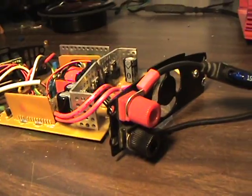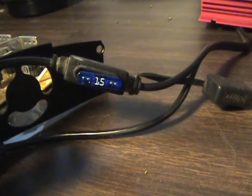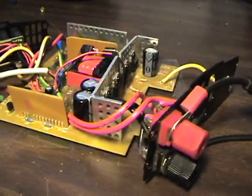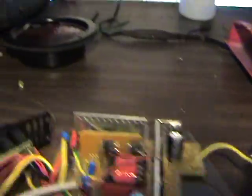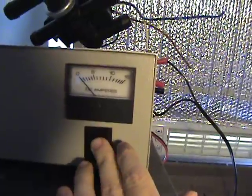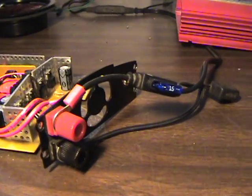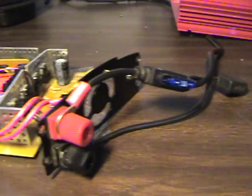I've got this wired up to my power supply, and just another word of caution — I've got a 15 amp fuse in there, but a 7.5 amp fuse is what came out of it originally. This is a bad idea — don't do this. I'm just using that to demonstrate what's going on and what can happen if you put too big a fuse in there. We've got a short in here, it draws way too much current. I'm just going to kick this power supply on just for a second so you can see what happens — just watch that needle. Bam, up to 15 amps. Something really wrong in there, a dead short somewhere. Left on long enough, either that bigger fuse would blow, or my wires would melt, or the power supply would be damaged. Just an illustration — don't do that.